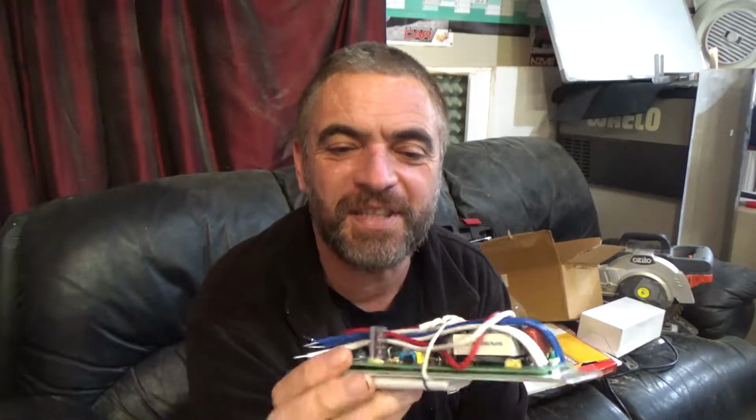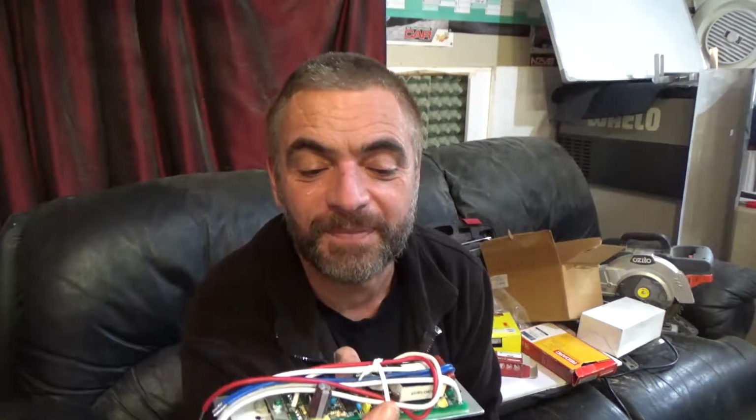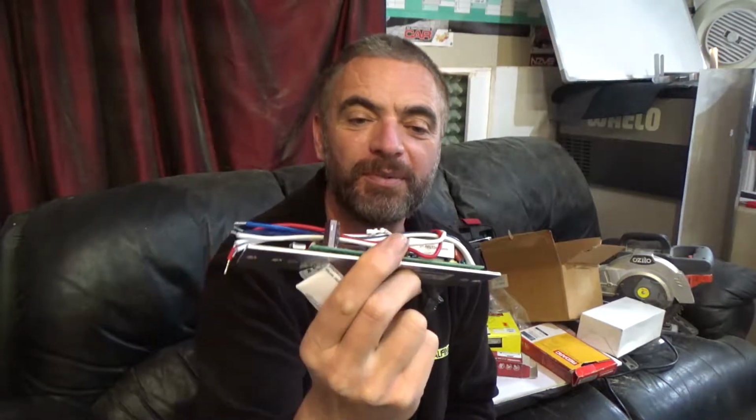They used to be more useful before the days of LEDs, but this is actually a mini inverter, a mini 240 volt inverter. Oh, I think it's actually 220, but for running fluorescent lights in a car or a truck. If you're converting a bus, you will have seen these in the overhead lights that were in the bus, which were originally fluorescent, and they each would have had one of these little units in them. Possibly a smaller one if they were a small tube. These are quite powerful ones. Yeah, they'll run a 40 watt fluorescent tube.